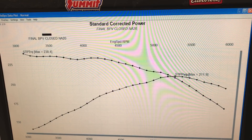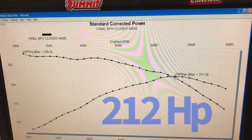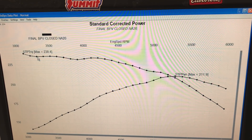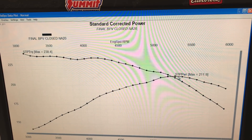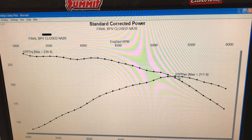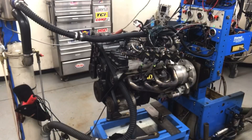Here's what happened when we ran the motor naturally aspirated, still on E85 like the supercharged combination. Our 3800 Series 2 produced 212 horsepower. Peak torque was 238 foot-pounds, although that's kind of the loaded number - 235 is probably more realistic. It's interesting that the torque is up pretty good down low given the short runner manifold. The motor made peak power out at around 5200 RPM, then power fell off - it has a mild cam.